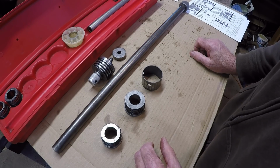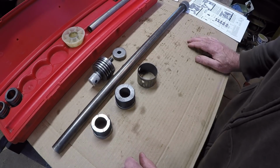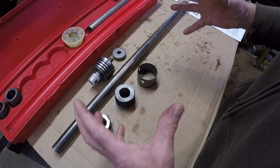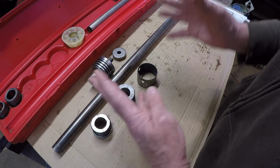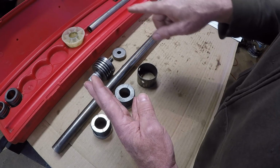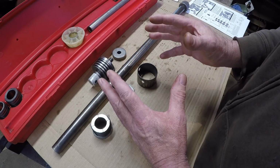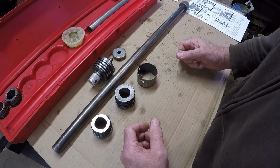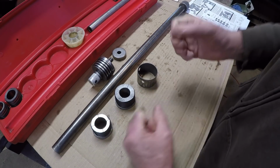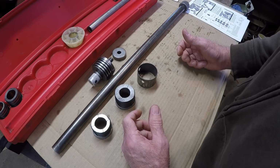Another good one was to heat the block and cool the bearings. I used to do a lot of work on snowmobile engines, basically the Rotax single cylinders, where this would come in. They have a press fit on the roller bearings from the crankcase to the case, and what I would do is take a propane torch and do about 10 revolutions outside the case where the bearing goes. You tip that up, hit the crank on a block of wood, pops right out of the case. No hammer and beating or anything like that. And according to service schools, you'd think beating a crankshaft on a block of wood is not good, but that was, according to service school, a procedure to do it, and it did work good. You didn't have to hit it that hard.